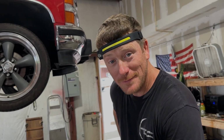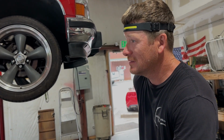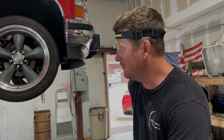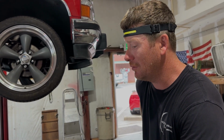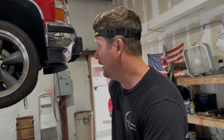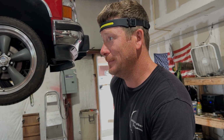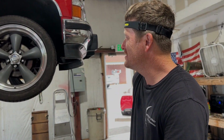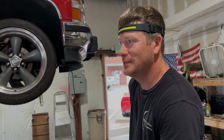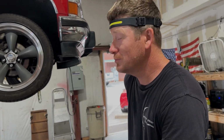Well, after I finish installing the gauges, I'm about to tap into the fuel sending unit now to run up to the gauges so that the fuel gauge will work on the gauges there in the cluster. Other than that, I've got to run a 12 volt switch off the Holley trans harness, and I don't even remember. But there's progress being made, visible progress. Chipping away. Close. Chipping away. Also, I got to pick up the drive shaft here in a little bit. Yeah, I just went and had me a good cry, so just moving along.